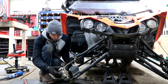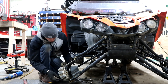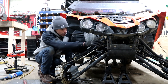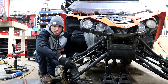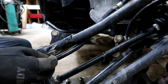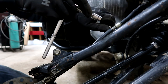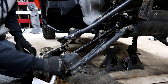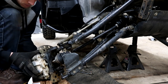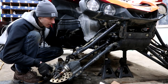I was trying to get the tie rod off, but both ball joints came out. The reason why I'm trying to get the tie rod off is because I don't think I have the clearance to get everything out. But maybe I do — I'm going to take this brake line off anyway because I'm going to clean all this control arm off and the brake line runs right down it. So I guess I don't have to take the tie rod off, but that saves me time on the other side.